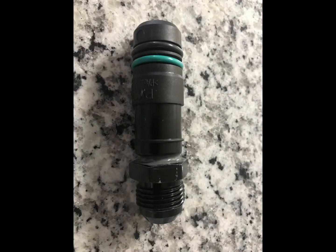Next to the spider hose, you will see the plugged piece — a plastic piece. As you can see, I drilled a hole and used JB Weld and a 10AN fitting. It's a half-inch thread NPT by 10AN. JB Weld holds pretty good — never had any issue, used it for a year. So this is one of the mods you have to do.